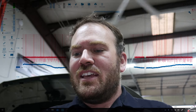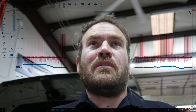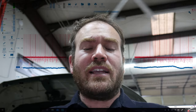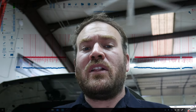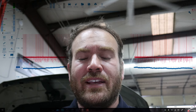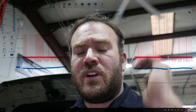The only thing referencing outside air is the oil pressure switch. My WPS 500 is comparing the pressure at the oil pressure port to ambient air pressure at my altitude — it's a relative sensor, comparing the two relative to each other. But if I have vacuum in the crankcase, wouldn't my oil pressure relative to the crankcase pressure be the same regardless of what I'm measuring with my sensor?